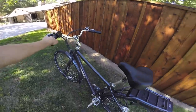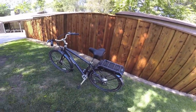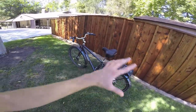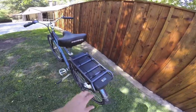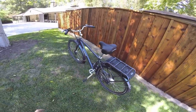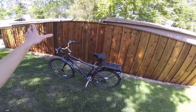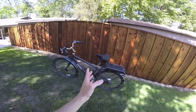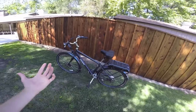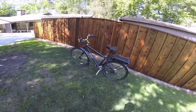If you live on the East Coast where it's cold, or in the desert where it's hot, just bring the battery inside and keep it cool and dry. Try to keep it between 20 and 80% charged if you're storing it for a long time. You can check how full it is even when it's off the bike by pressing the voltage readout on the LED display. They've done everything they can to help you manage the battery. The warranty is one year full coverage on the battery, with coverage up to three years where they offer a replacement plan at a discount in years two and three — it benefits both parties really well.